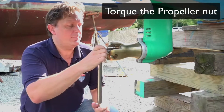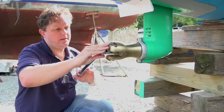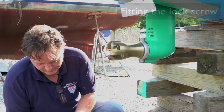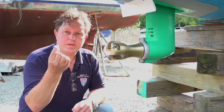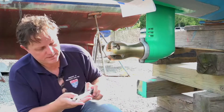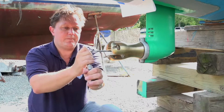Next, we'll get the torque wrench. Now the next most important thing is the lock screw — it comes with it all set in. So you just need a little bit of loctite. I use a bicycle torque wrench for this — it's just set in newton meters, it's small. Set to 15 newton meters. Okay, it's done.